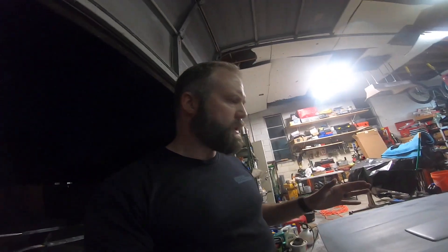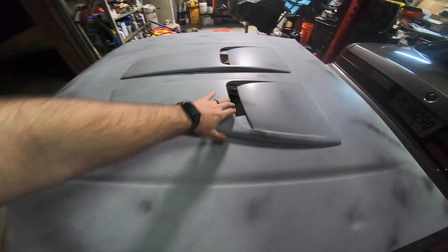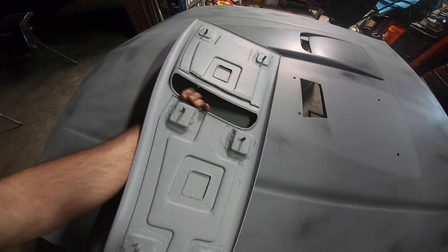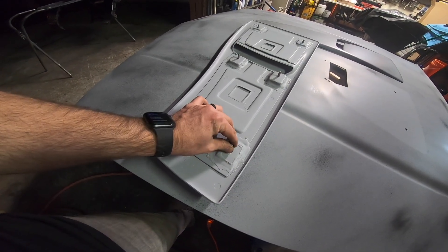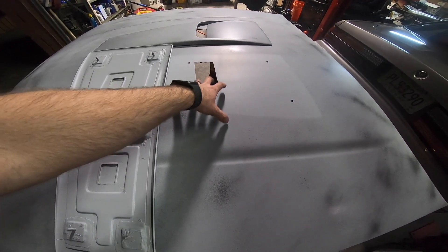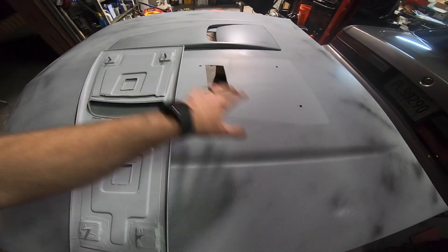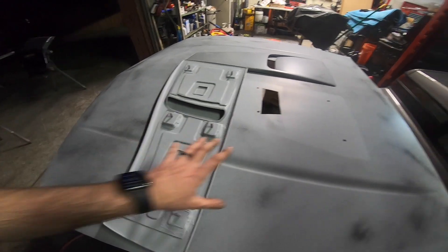Here's a quick rundown of where we're at. I've got the hood off the car and the hood blisters are done — check these out. They've been heavily modified. I had to cut these stud humps because they stuck up quite a bit higher. These are supposed to sit down into a trough in a hood made specifically for an E28-style hood with these vents. I have a flat hood because I have an RS car, so I modified these to work with my flat hood.